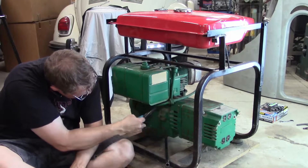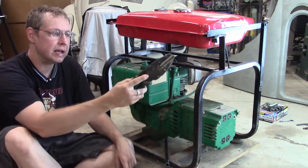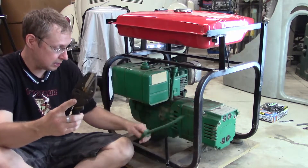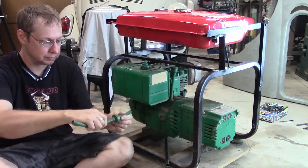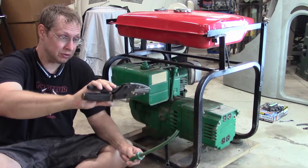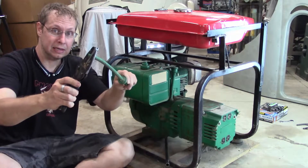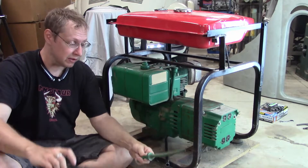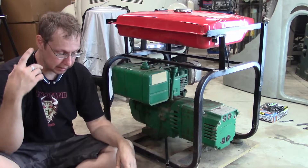First and foremost we just have to snip off the spring clamps here and move those out of the way - pretty easy. I have this tool, an AccuCut - if you don't have one of these they're sweet, cut super quick. Look at that, the whole thing fell right off. These are Craftsman; I don't know if they make these anymore, but if you can find anything similar to these buy them - they make cutting all of your hoses super easy.